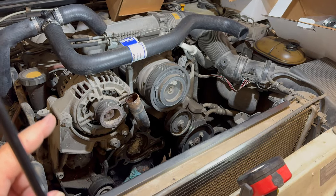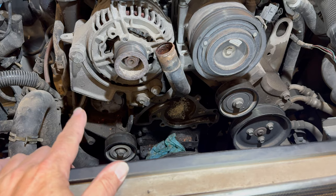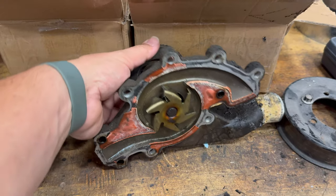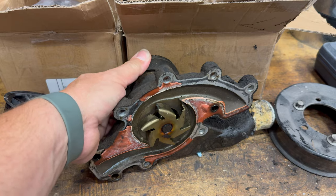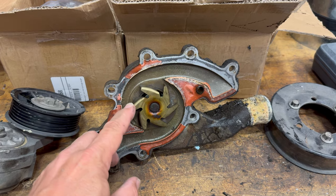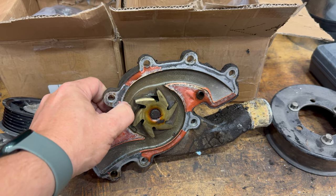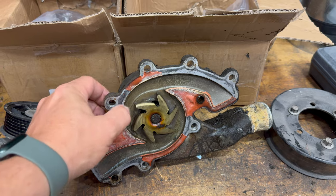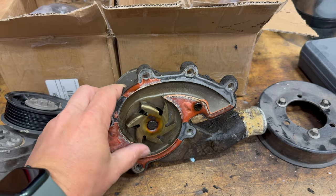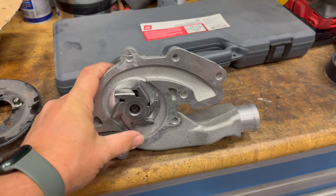While taking things apart to install the new radiator hose and thermostat, it was discovered that the water pump was also leaking and the belt tensioner had bad bearings. So now I have a new belt tensioner and a new water pump. Looking at the old water pump, the bearing feels decent as far as play goes, but one thing you don't want on your Land Rover is for the bearing to develop so much play that the impeller starts wearing into the back surface of the water pump. This water pump isn't that bad, but if we spin it...